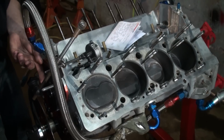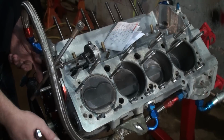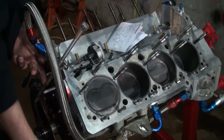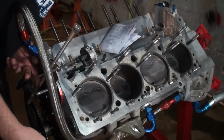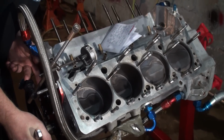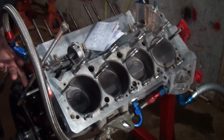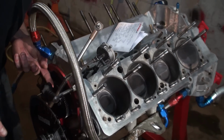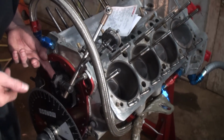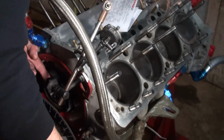Okay, so now we have our lobe lift. This is a little bit different than what's on the sheet. You just document that for your records. It's not a big deal. 3/1000 isn't going to hurt you that much. And then our first reading is going to be at 50/1000 of lift. Now this is where we're actually checking to see that the camshaft has been reinstalled correctly with the proper shims, and that's just to the manufacturer's spec.